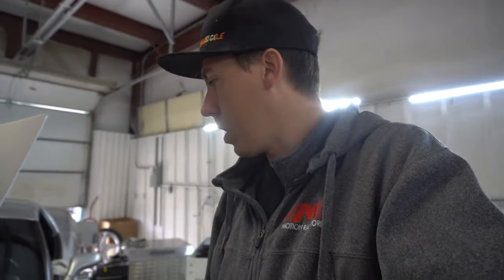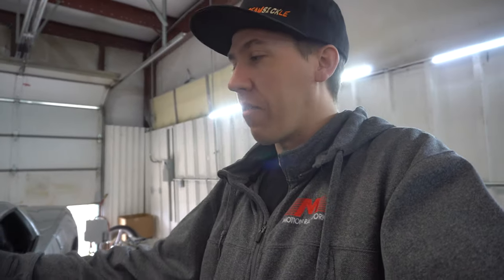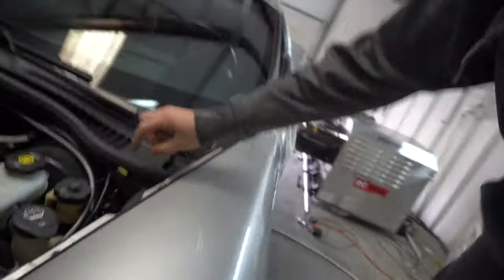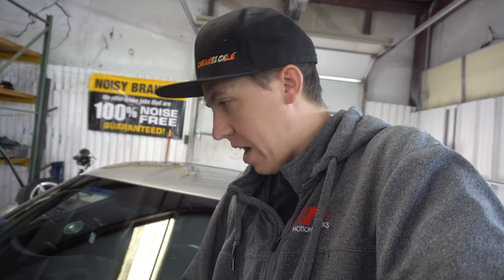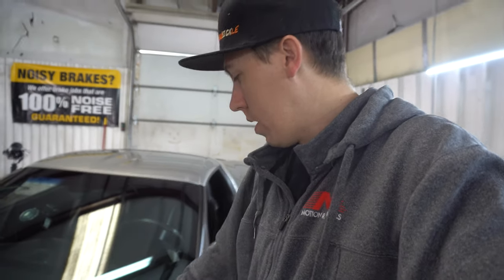I haven't done a lot of these where it's got boost and mass airflow with an aftermarket supercharger, so this one has it. I'm going to keep an eye on the mass airflow — I know these cars can run out of mass airflow at some point. A little bit of learning today, just watching everything, making sure vitals look good. I've got HP Tuners all hooked up, credits downloaded, stock tune read, and the O2 sensor in the back already hooked up. Going to pull this fuse, make sure everything looks good before we spray methanol, then start spraying and dialing that in.